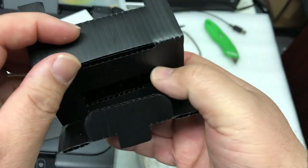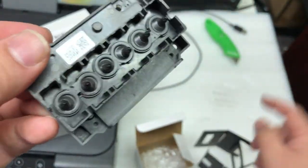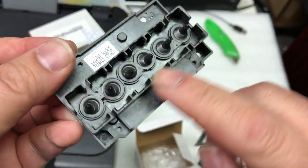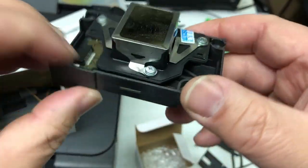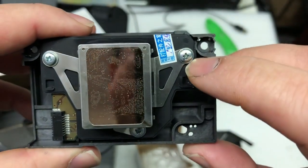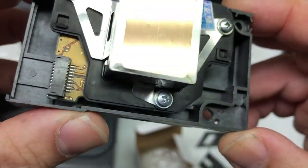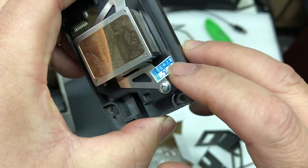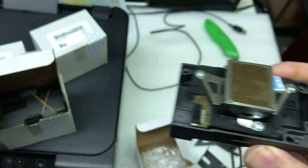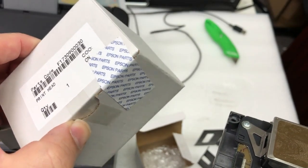I really don't pay much attention to how clean it is — if it's dirty, it's definitely not new. The old ones can be made really clean too. What I pay attention to is those three screws and whether they look bluish. The guy put a label here, so this one is not the kind that's brand new from the factory. Those new ones are sent by Epson to repair printers — that's why they don't have a flashy outside box.